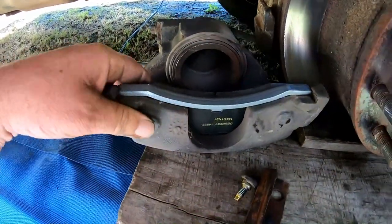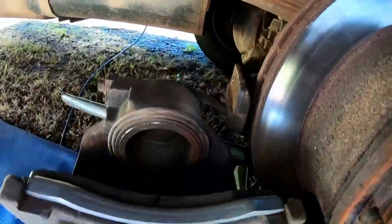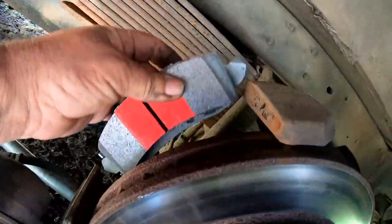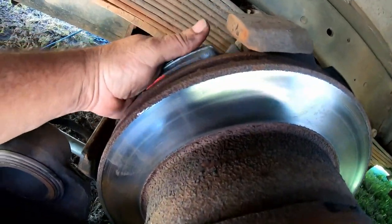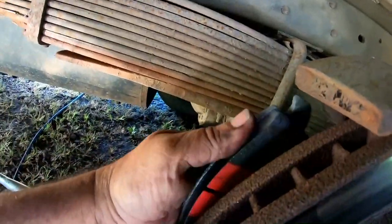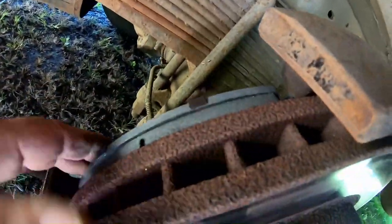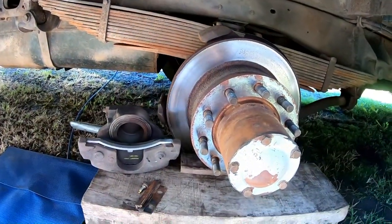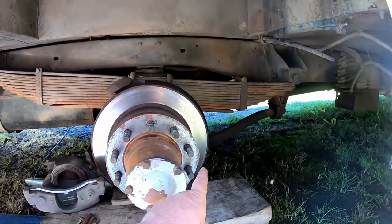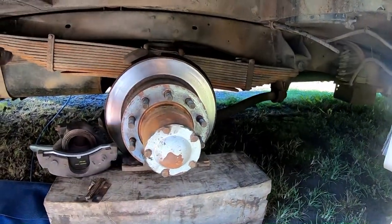I'll need two hands — it's a really neat fit. The other pad sits back in here, there are two notches where this slides into place. There it is, that's in place. I just put the rotor back on, tap the thing in, put the bolt in, and that's it. Put the inside wheel on, put the extension on it, then put the outer wheel and tire on and put the bolts on — done deal.